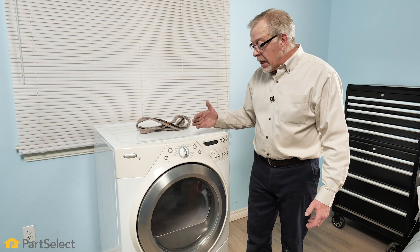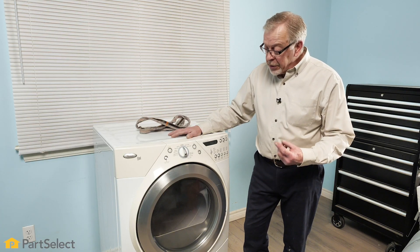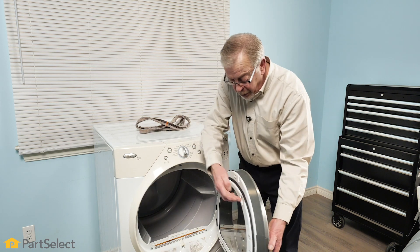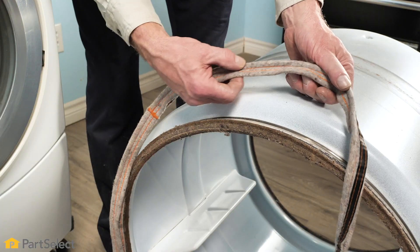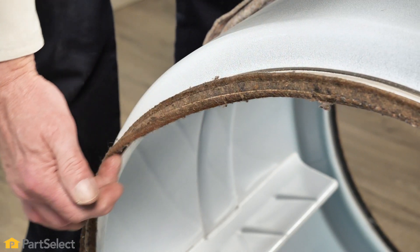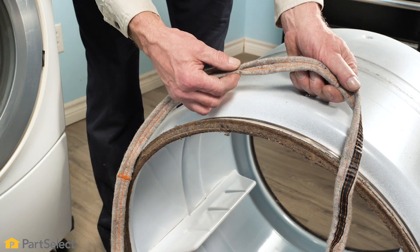Now that we understand how a clothes dryer works — sucking air through the drum and exhausting it to the exterior of the home — if we don't have good airflow, lint is more prone to build up inside of the dryer. To increase airflow or make sure it's maintained properly, we need to make sure that our door seals are in good shape. Inspect those, make sure they fit nice and tight with no rips or tears. If so, they'll need to be replaced. We also need to make sure the dryer drum seals are in good shape. Typical dryer drum seals are attached to both the front and rear of the drum and they will mate up against either the rear or front bulkhead. Inspect those carefully — if they show any signs of wear or if they're dried or cracked, you'll need to replace them.